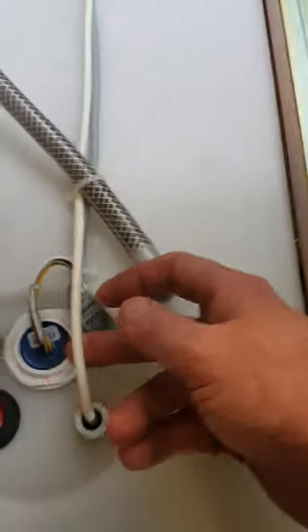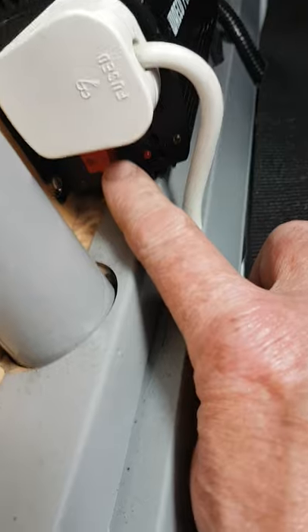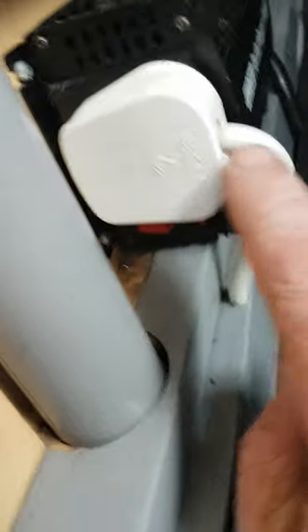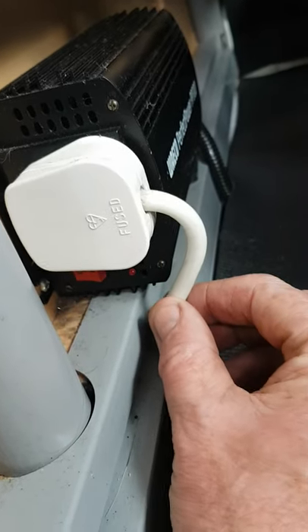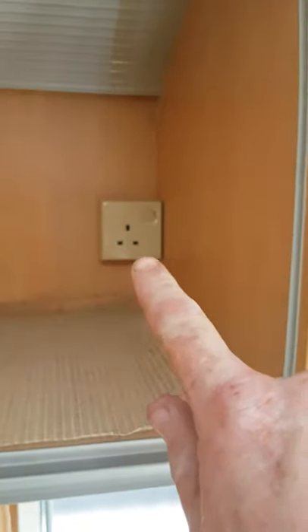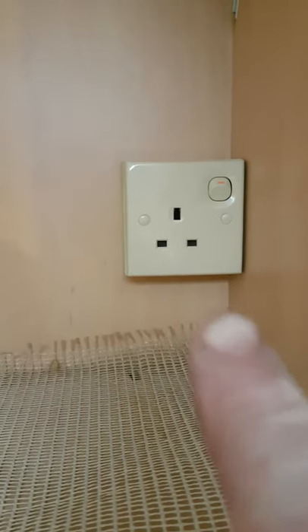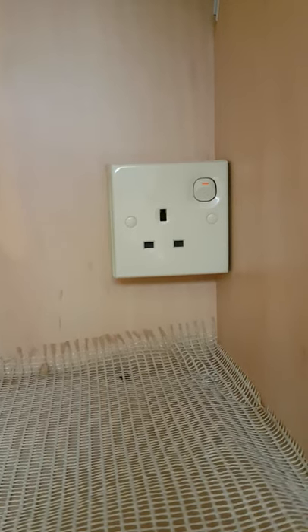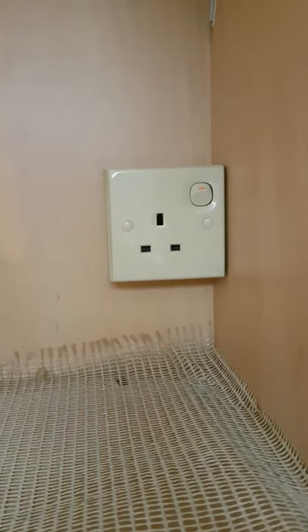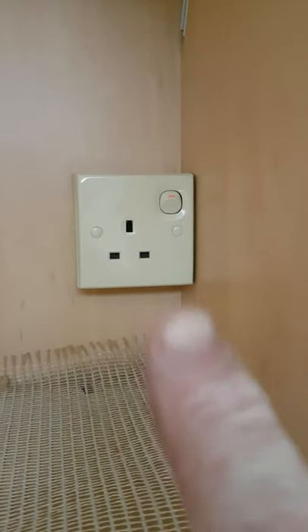Your wires for your pump are these wires here — if you ever need to change your pump it's straightforward enough. There's also an inverter on this van — you can see the little red switch — and what that does is convert 12-volt to 220-volt AC. The socket it supplies is the beige one up here beside the TV. You'll get 220 volts but only 150 watts out of it, so it's really only useful for charging phones or laptops when you're not plugged in. It's not made for cookers, toasters, kettles, or any high-draw appliances.